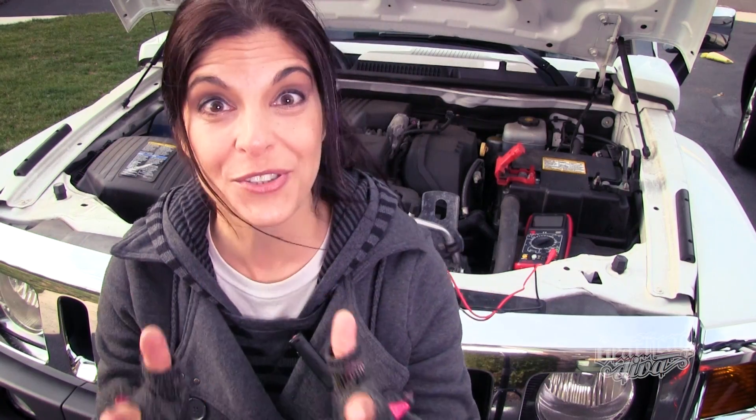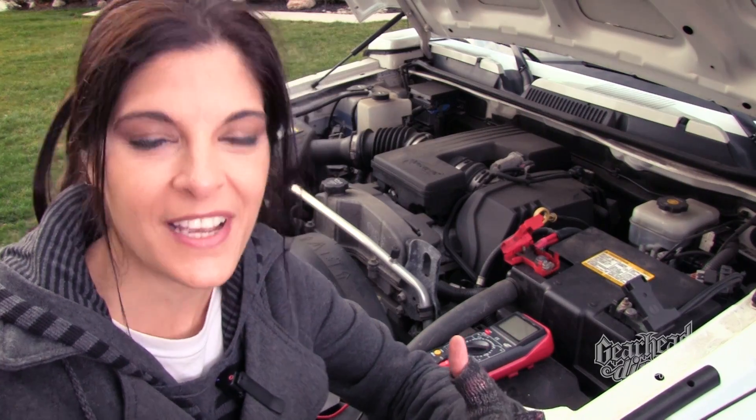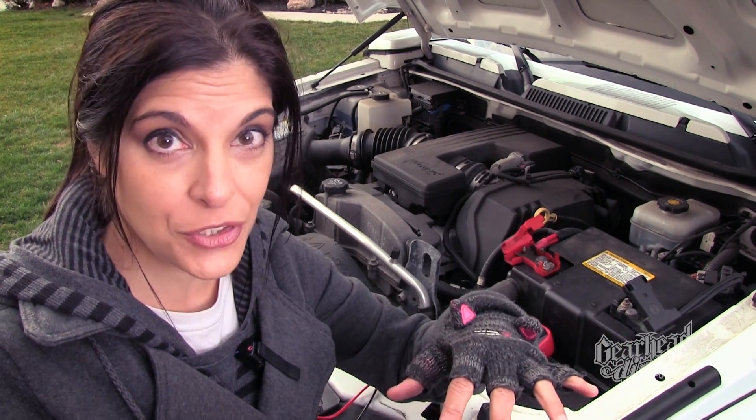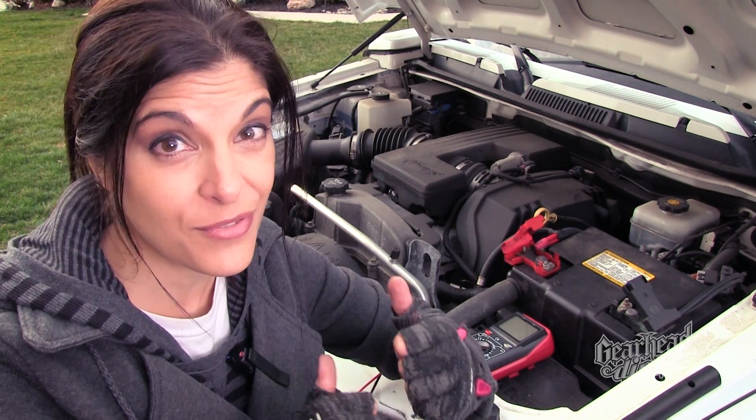How are you guys making out with your alternator so far? I'm ready to move to the final two tests. But if from the get-go your basic output test was already on the low side and then the load test couldn't get that 0.5 volt minimum over your initial charge, all is not lost — stick around. Whether you're passing these tests with flying colors or struggling a little, it's still important to check out some of these items because it's going to tell you a lot about how you'll do on the final two tests.